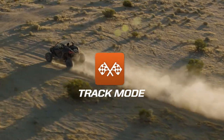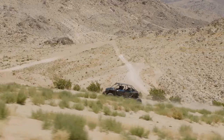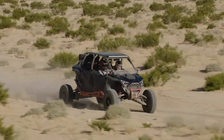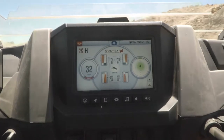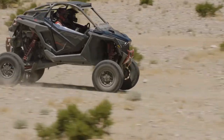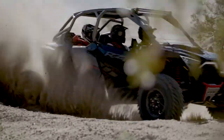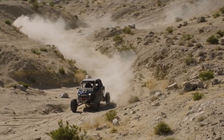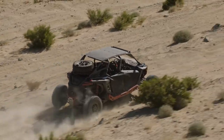The last mode in the Dynamics DV system is the track mode. This mode is intended for tight twisty trails or short course racing tracks. The damping control in this mode is characterized by medium compression damping and high rebound damping. What this does is it sucks the vehicle down closer to the ground, lowering the CG for optimized handling performance. The events on this mode are calibrated very aggressively so that when you go to make a corner, this thing handles like it's running on rails. The power steering in this mode has slightly higher effort so that the driver can really feel what the front wheels are doing. Because of the added bump rejection features in the power steering, you still will not feel bumps or impacts when you're running in this mode.